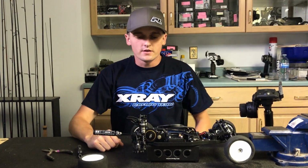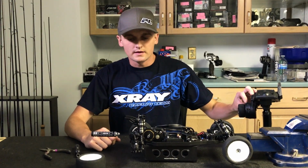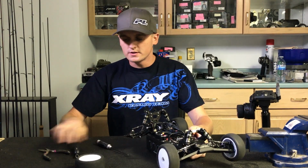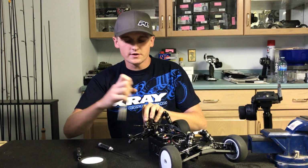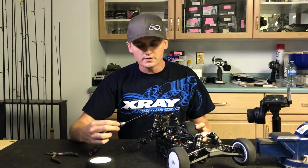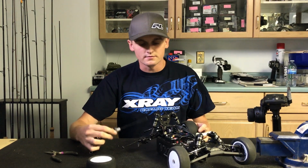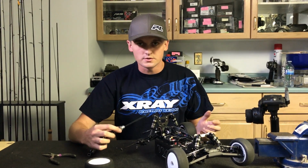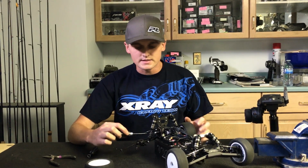So it's been running for about another 5 minutes, so I'm going to make my next adjustment. And when I do these adjustments, it's better to not turn it too tight. You can make little adjustments and do it more often. It's not going to hurt. If you do it just once tighter, it's not going to break in the diff as well, and you possibly have the chance of making it too tight, and then it just kind of messes everything up.